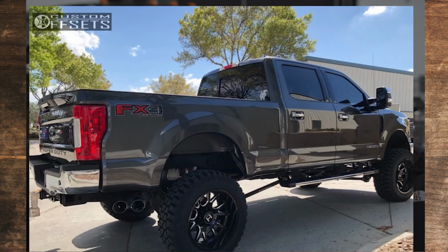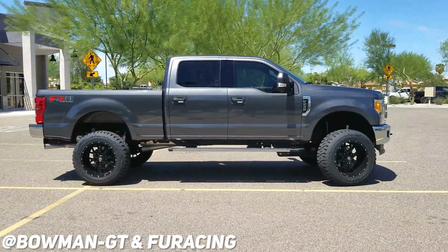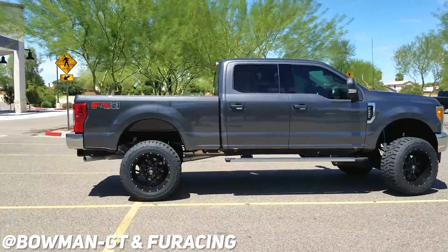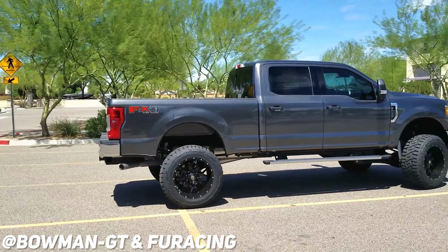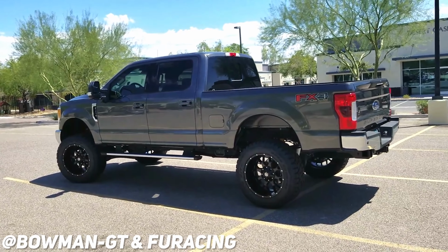the factory block from the rear axle, meaning that you won't have to worry about trying to line them up and bolt them together. It gets weird trying to clamp them down, trust me. As always with Superlift, this kit features their exclusive SL series shocks or allows you to upgrade to those Bilstein SS series shocks should you so choose.